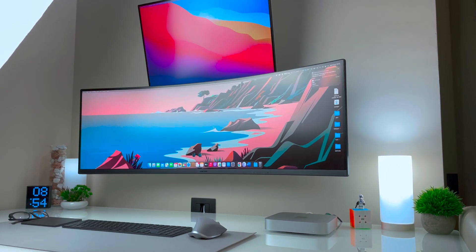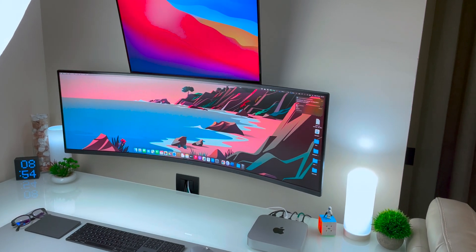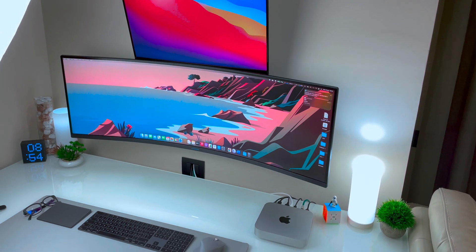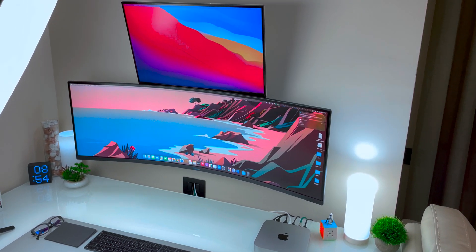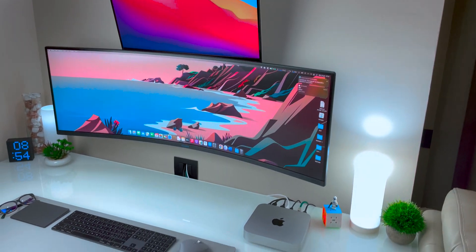And the other monitor runs via HDMI, but limited to 60fps. You can't use both Thunderbolt 3 ports for monitors — it doesn't work. You can only run one via Thunderbolt and the other via HDMI. In this way I can work with my video timeline on one monitor and review the HDR look on another, and from my early testing all of this without compromising performance at all.